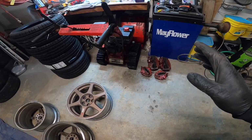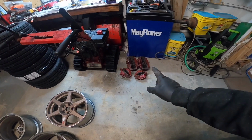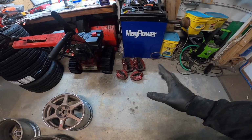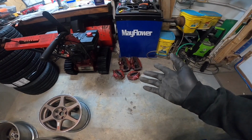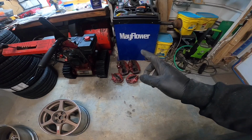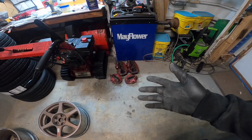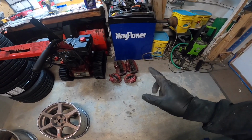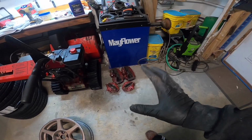If you have anybody that's looking to get their stuff powder coated, these Brembos, you really don't need a rebuild kit. Everybody thinks that that's something that they need. You don't really need that. Unless somebody ripped a boot or a piston seal or something like that, then you would have to rebuild them. But in my professional opinion, I've never had to rebuild one of these things with new seals and stuff like that. So we'll go through that whenever I get the chance.